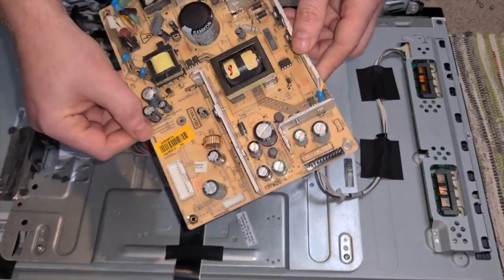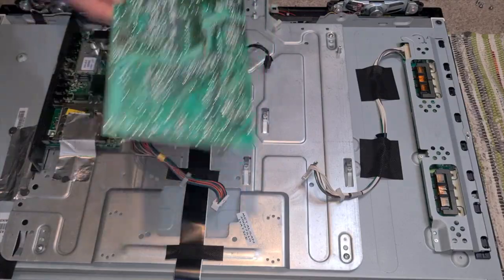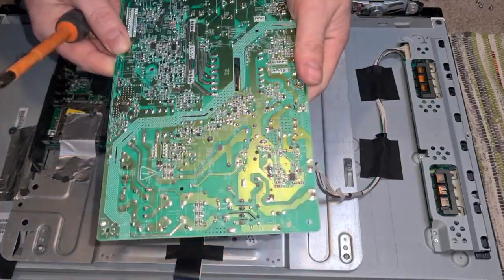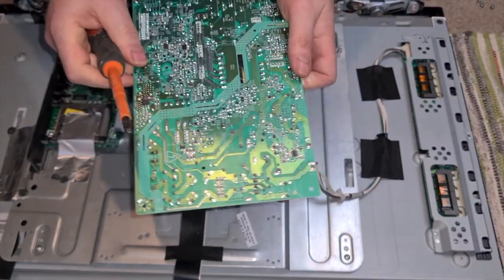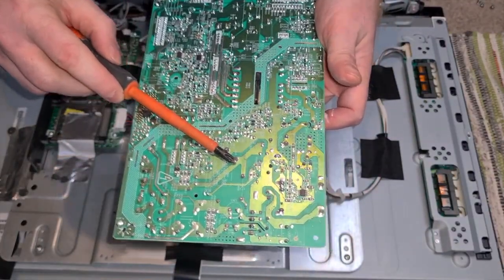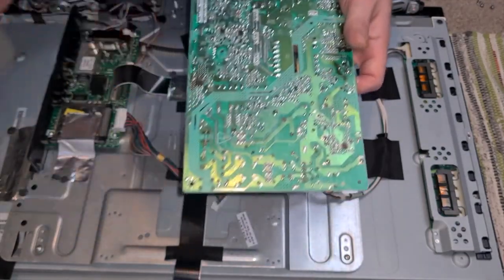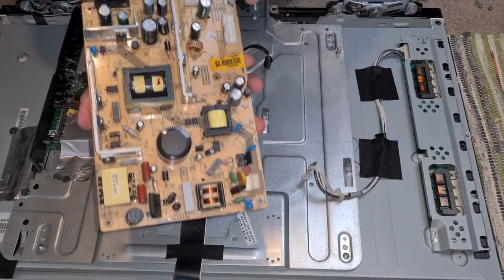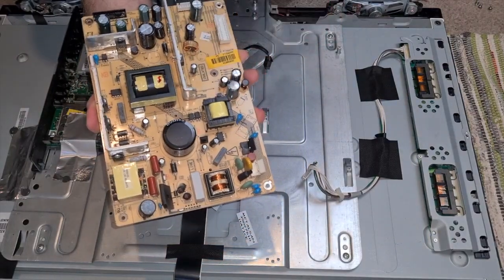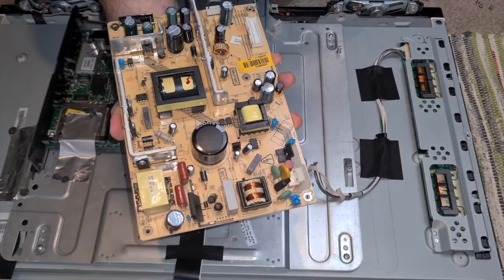Okay, that scary moment has been done. I sat down downstairs and crossed between those two pins with the screwdriver and there's zero — no reaction at all. So that is now safe. I'm going to desolder this one, put in the new one, and then we shall rebuild her and see if it's worked.